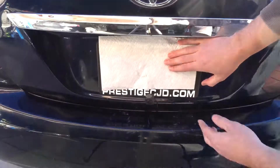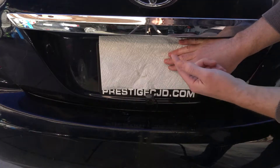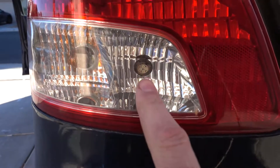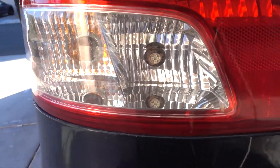I decided to install it right under the license plate, so this is the camera just sitting in the back of the car, and all the electronics are inside the trunk itself — they fit right under the hinge. It should have very good wireless communication all the way to the mirror in the front. I stole power from my rear reverse lights, which is how you're supposed to install it — as soon as those lights turn on, the camera comes on and the transmitter starts to transmit.